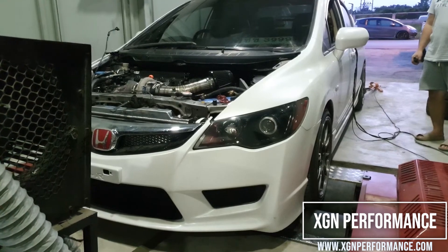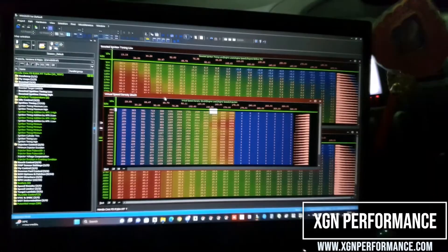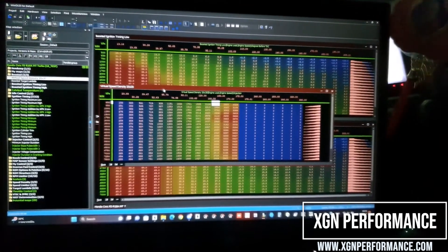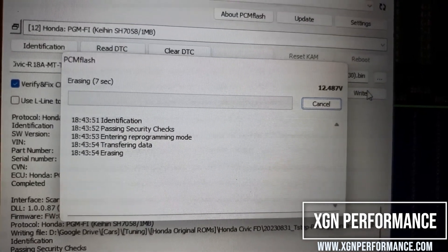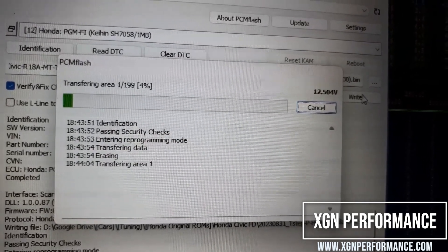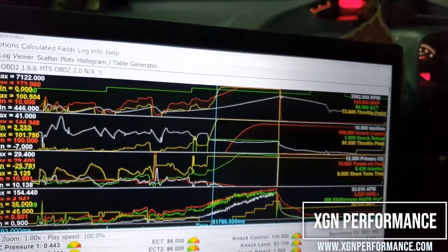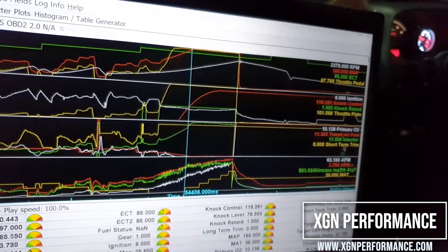The Honda Jazz is done and now it's our time. The car is on the dyno, but we actually did the street runs last night before today. This is the speed density table and the ignition table that I created and extended to handle boost — they are working very well. The software I used to edit the ROM is WinOLS, and the tool I used to flash the ECU is called PCM Flash by a Russian developer. It's very stable for Honda; I used this with the TACTRIX cable and the SCAN Medic 2 Pro, which works well.